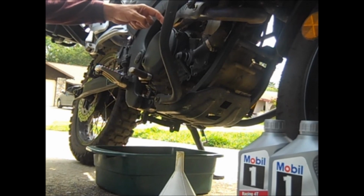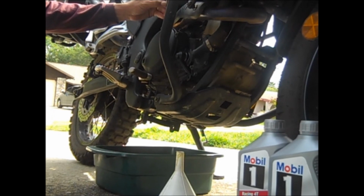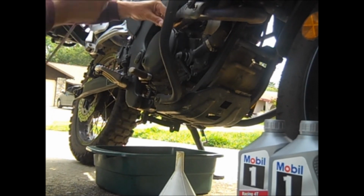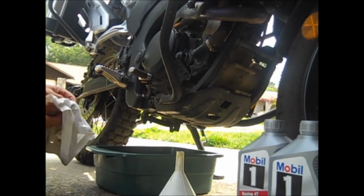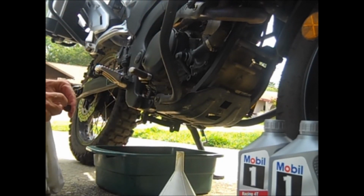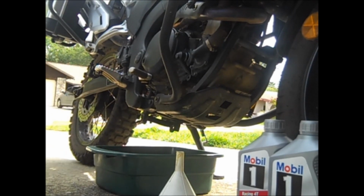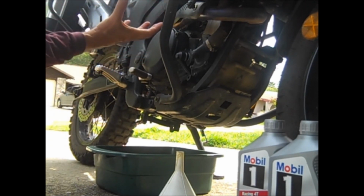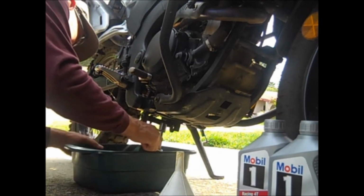And this one, I'm going to use a screwdriver to take it off, but it's designed so you can literally stick a coin, penny, something in there to take that off. They actually show using a penny online to remove it. It's got just a little recess there. It looks like it's designed where you can get a coin in there if necessary to add some oil if you have to. And we are going to go ahead and, now with the two oil plugs open, it should allow the crankcase to drain fully. There's not going to be any suction up in there. We're going to come down here.